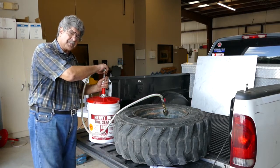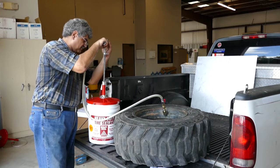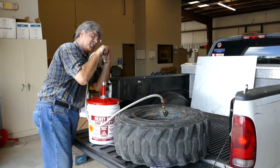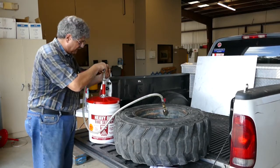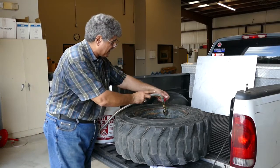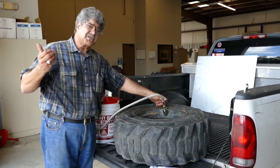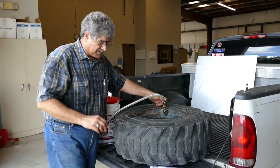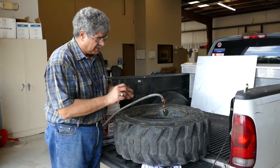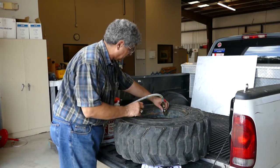Let me go ahead and give it some pumps — I won't go through all of them, just once or twice now. It's important to pull the plunger all the way to the top. Now I've already primed this before. This is a really tricky part: you have to make sure you shut the valve off when you're done. If you don't, all that pressure will push the sealant right back out at you and make a mess. So I'm going to get my valve stem ready and push it back in when I finish to get it back the way it's supposed to be.